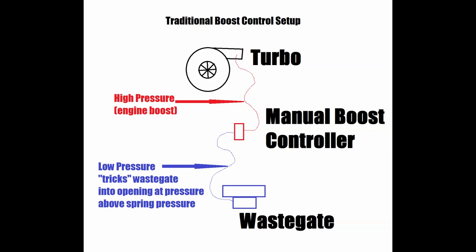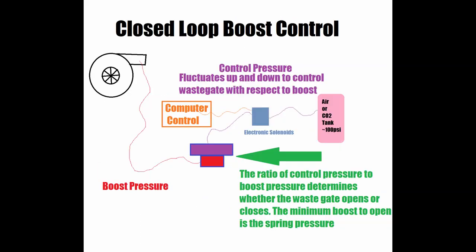This can lead to a lot of issues, and one of the biggest ones for me is traction at low speed. If I were to launch my car at 16 pounds, it wouldn't go anywhere. So I like to be able to launch at 4 and ramp up to 16 pounds.